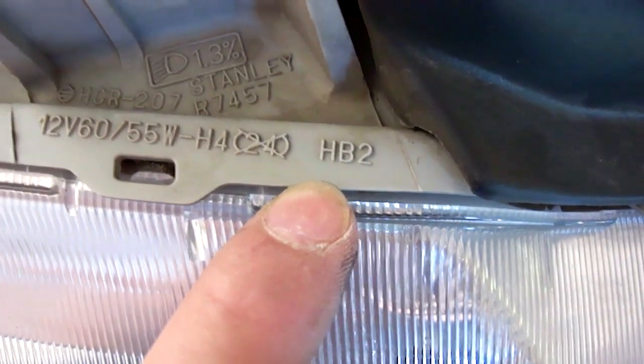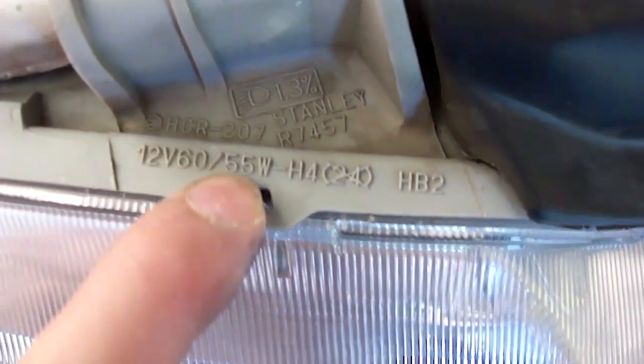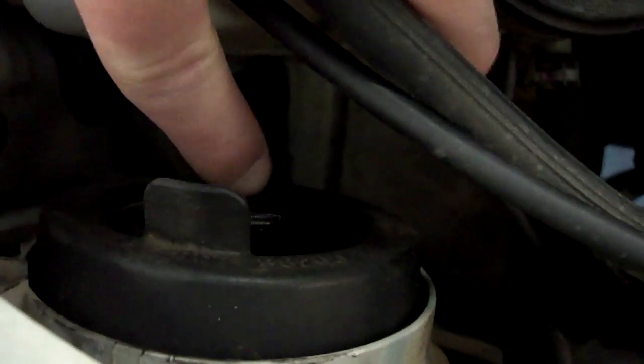Alright. So to change a headlight, you remove the rubber weather seal, or you can remove the cable first. Now the bulb, I'll once again list it in the description, but I'm pretty sure it's a 9003. That's the same exact bulb as an HB2 or an H4. And it's a 60 watt high beam or 55 watt low beam bulb. But you remove this little cable. All you have to do is pull it straight out, this, and then remove the rubber weather seal.